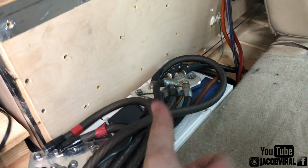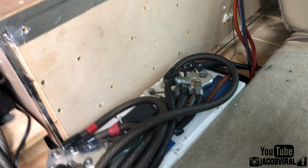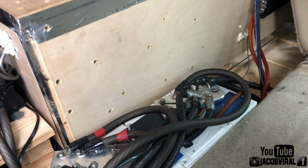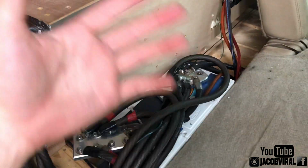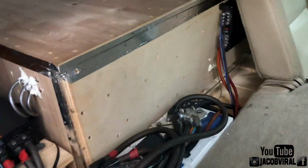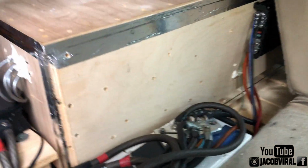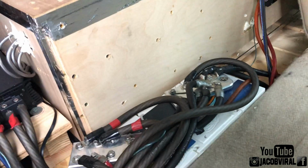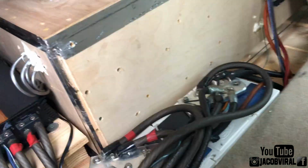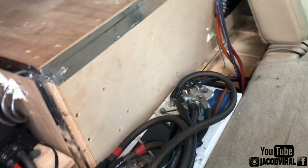I always recommend battery reserve first. Your alternator needs to be upgraded too, but an average person that isn't going to have more than a 2,000 to 3,000 watt system isn't going to really need a high output alternator with a daily driver system, as long as they have a good battery bank reserve. The alternator is going to struggle, but you're going to need more battery reserve first. You're not going to want a stock battery or a single battery up front and no battery in the back with a high output alternator. A 300 amp alternator with just 40 to 60 amp hours of battery reserve under the hood isn't going to cut it. You're going to want that battery reserve to help support it.